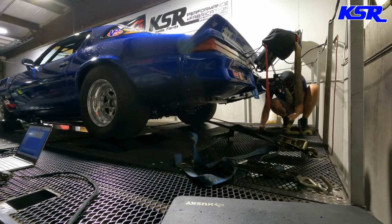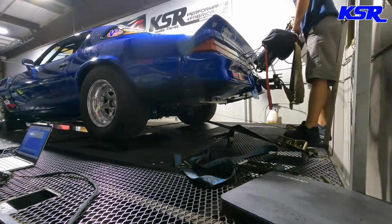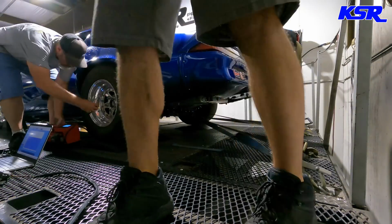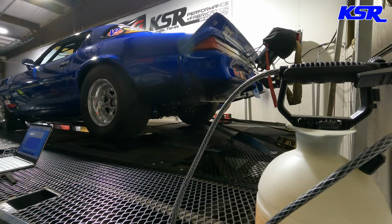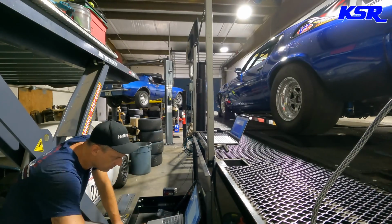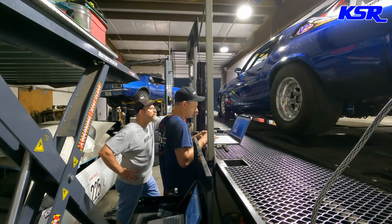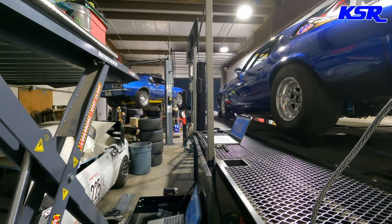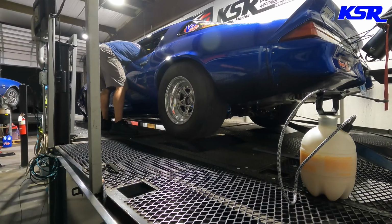put back onto the dyno, because you can easily spend a full day dyno tuning a turbo car and getting all the individual cylinders balanced with timing and with fuel, as well as different boost levels. If it's a street car, different fuels with blending in ethanol. Lots and lots of time can be spent on a tune. So don't take your turbo car to somebody and expect them to hammer you out a complete custom tune for 400 bucks. It's just not realistic.